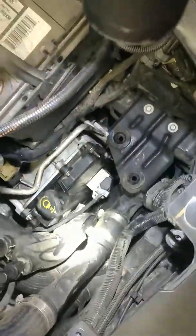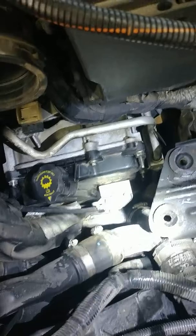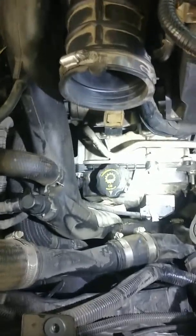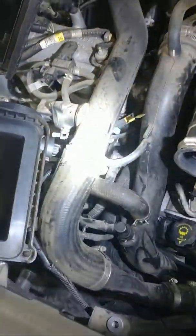So that's one of several possible places these 3.5s fail — check all of your connections and all of those hose clamps. It can be a little bit of a challenge to look down in there and see what's torn. This one actually failed because the transmission fluid got super hot and came out through the little vent cap right here, splashed down on top of that rubber hose, and the rubber hose is the first thing to go — which is the pressurized side. This is the piping for the pressurized side of the front turbo. There is one on the back too; you can follow it around, and if you look down in there you can see there's another little rubber hose that blows off or breaks as well.